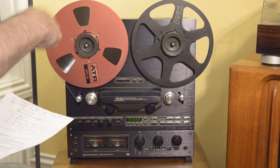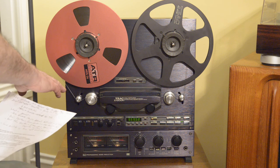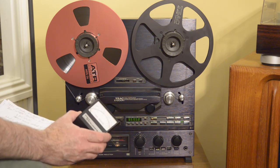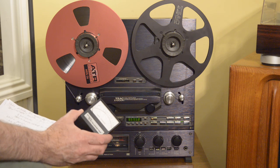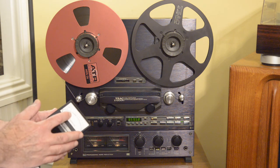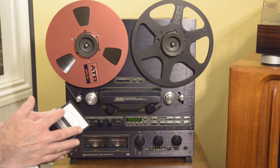Just a note on the spec. After the mechanical restoration — which includes the mechanical adjustments, your tape path, your tape tension — if you're going to set tape tension on the head stack, which is an essential step, you really need a tape tension gauge. These do show up on eBay from time to time. You want one with a scale no higher than 200 grams at the top. If it's up around 400-500, the tensions you're looking to set are in the range of about 50 grams. For most tape decks you're going to be in a range of 50 to 80 grams for playing, and forward and rewind tensions might be up around 110. You want to be about mid-scale — not convenient or accurate if you're trying to set values way down at the bottom of the scale.